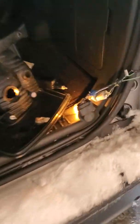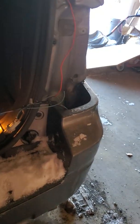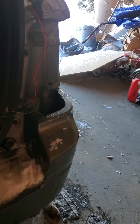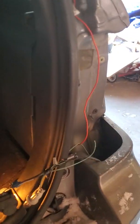I tore the brake light apart as you can see here — tore it all apart and it was just on, so I was wondering why. I had installed a backup camera and this was the wire for it, so I cut that and still nothing happened, so it wasn't that. I looked on some videos and they said it could be the brake pedal, so I checked all that — that all seemed to be adjusted good, all the hardware was good, no broken pieces as they suggest. But I figured if it was that, it would be both brake lights, but it was just the right side one.